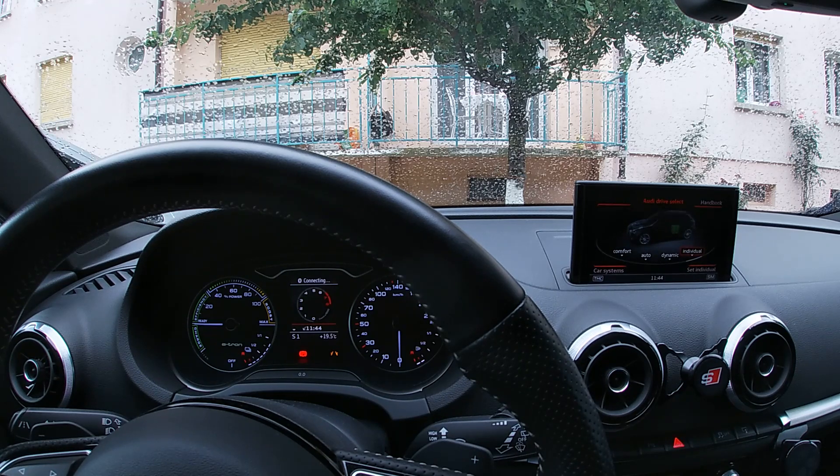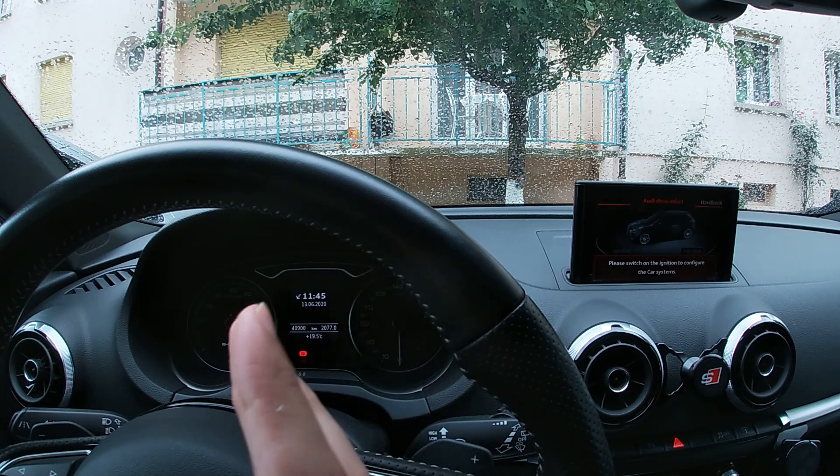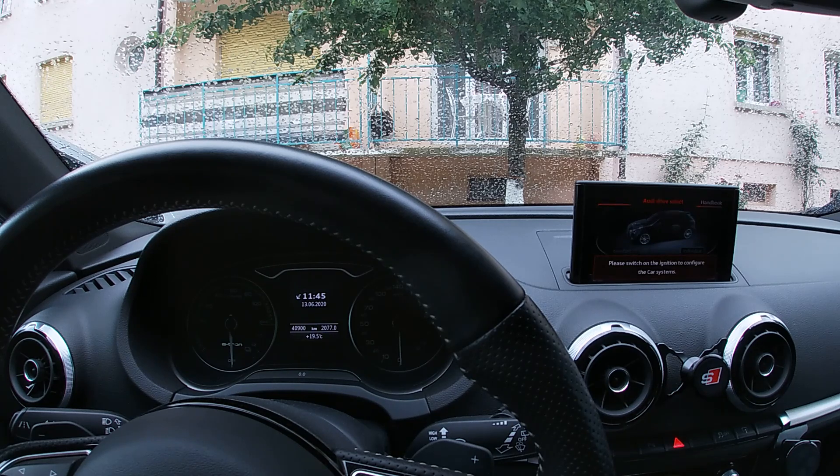So we have the hybrid hold mode. Then, just for safety, I will press the brake with the left foot and make a quick press on the gas pedal. You can see here the car did not move, and it engages the internal combustion engine. You can see the revs, the icon here, and also an icon which says that EV is not available. For this to work, it is mandatory that you have the seatbelt on — the car will not start if your seatbelt is not on. As you can see, the car is not high-revving because the quick pressure I'm doing, although it goes to the end of the gas pedal, it's too quick for the car to react. It will just say, okay, this man needs power, so I will turn the ICE on.